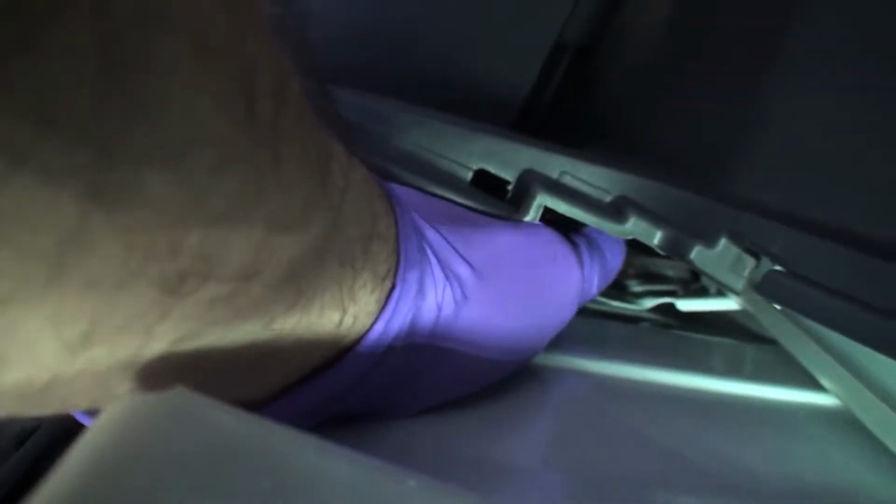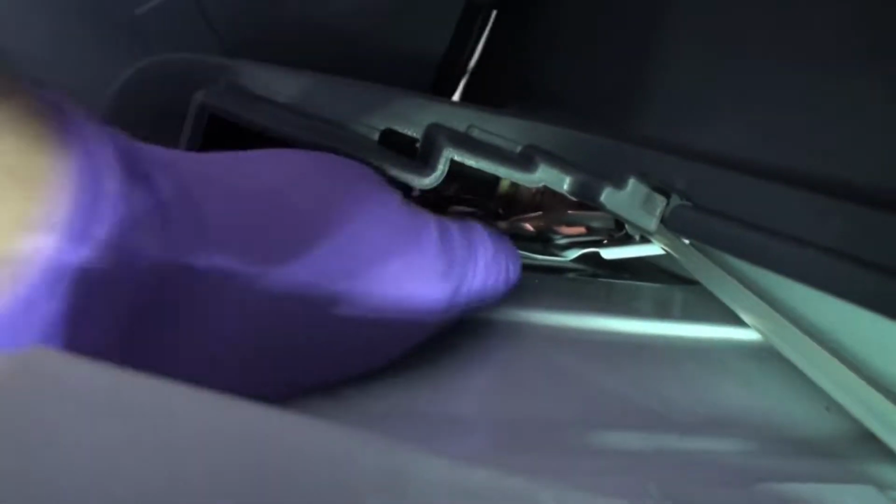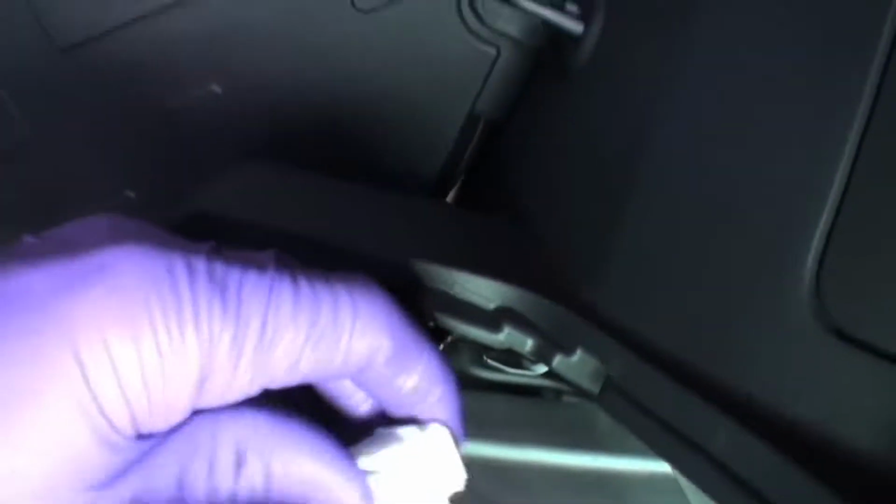Rear panel does not require full removal. You'll need just enough room to run the umbilical cable to the rear cargo tray opening. With the rear cargo tray off, you will be able to see a clear channel of where to run the umbilical wire. Run the wires as far as possible on the top side of the wheel well, then reach from the cargo tray opening to pull the remainder of the cable out.